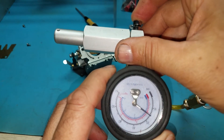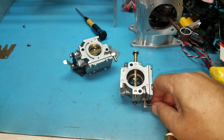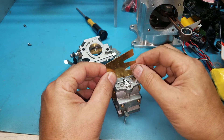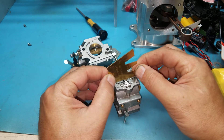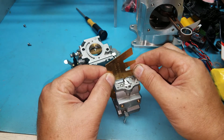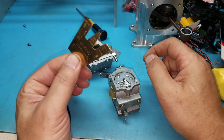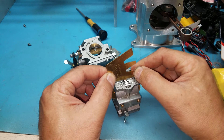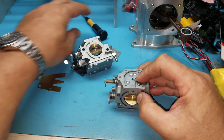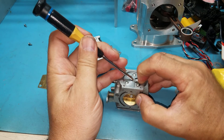That at least shows the two carburetors we'll be working on, and I will be adjusting the height. Right now it's high — this is 46 thousandths deep and it's for the WB. As you notice, there is a small WB, so you could use this fixture for all WB engines. The way you adjust it is you hold that down and with a small screwdriver you bend that tip.